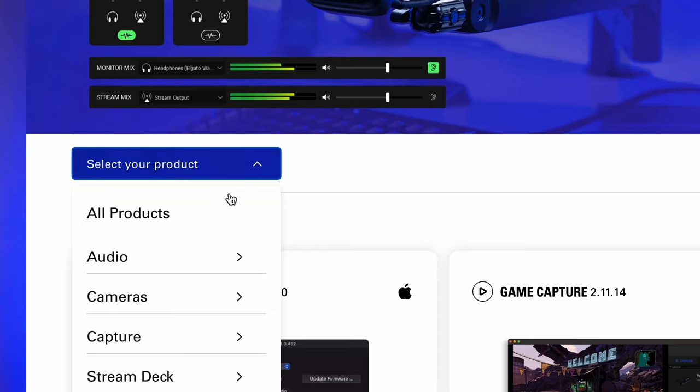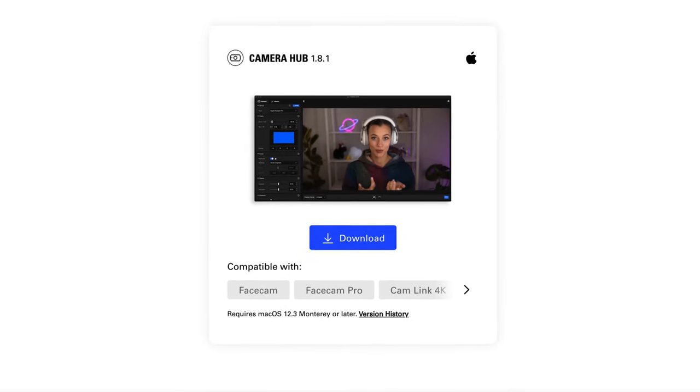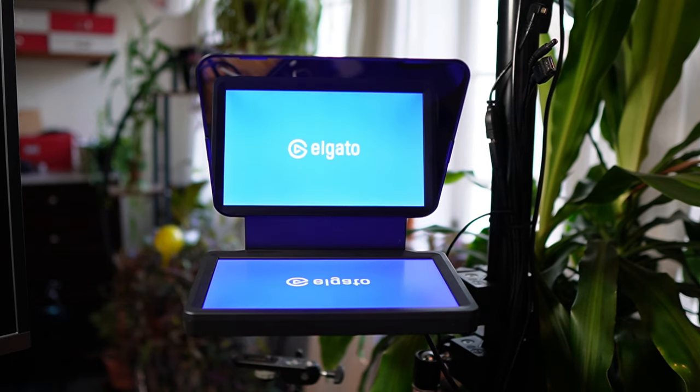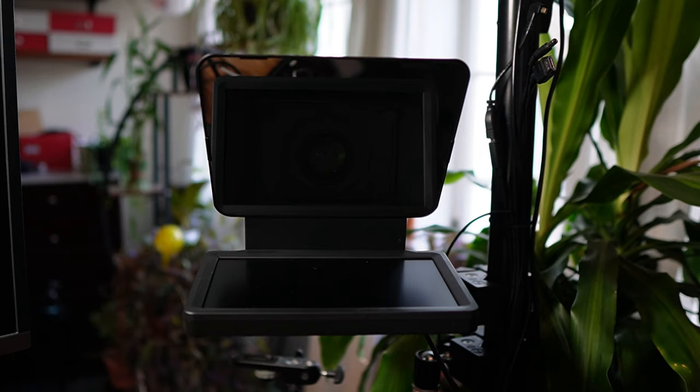It's time to make it work. Download the Camera Hub software, which will include the necessary DisplayLink drivers to actually make this work. You can get that by visiting elgato.com/download, go to the Camera Hub section, and click on download. The prompter will flash blue and then likely go dark. This is where most people get frustrated with the setup experience, because honestly, this part is finicky.